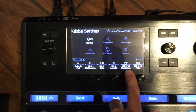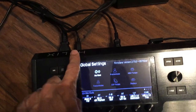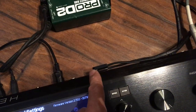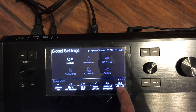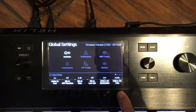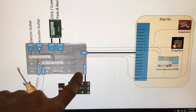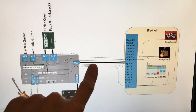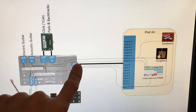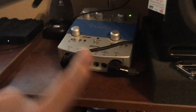When the iPad triggers some audio, that audio comes back through the USB. In global settings under the I/O section, there's a 'USB In 1/2 Destination' setting — this tells the Helix where to route audio coming in from the iPad. I've got it set to quarter inch, so it'll come out of the quarter inch, into my DI box, convert to XLR, and go to what would be the front of house. The 'USB In 1/2 Trim' knob lets you adjust the audio level.